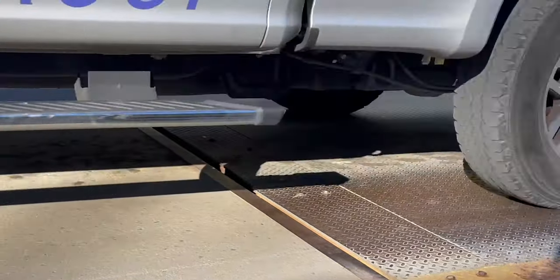You can do this with any truck — a pickup truck, trucks with trailers. If you have a trailer and want to know if it's overweight, take the trailer off your hitch, put a scale under the tongue to get the tongue weight — 500 pounds, 1,000 pounds, whatever it is — then drive over the scale to find the axle weights. Add the tongue weight and the axle weight and that gives you the total weight of your trailer. It's a little more complicated, but it's easy to understand once you work through the extra steps. So the next time you go over the scale, don't just run over it as fast as you can — try to understand your scale weight. I think it's worth the extra step. Thanks for watching.